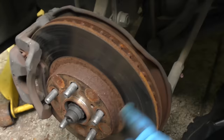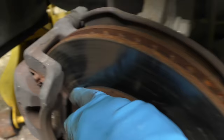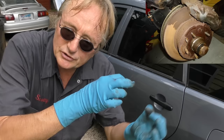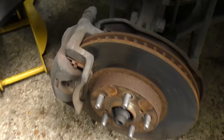Do the same thing on the other side. The front brakes are disc, and as you can see, the discs are pretty much open air — any dust on them just blows around and doesn't accumulate on the rotors. There's surface rust all over the place, but that means nothing. The only thing that matters is the part here that the brake pads squeeze to stop the car. These are vented rotors, so the heat vents through faster and makes the car stop better. The only thing to worry about with disc brakes is whether the pads are too thin — once they get thinner than a dime, it's time to change them so metal doesn't hit metal. If they're wet and have leaking brake fluid, either the hose going to it is leaking or the caliper itself was leaking fluid. This one is bone dry — no leaks anywhere.